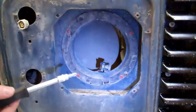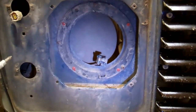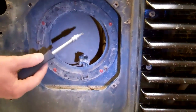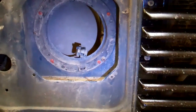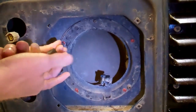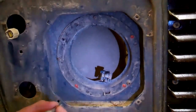So we've taken the old headlight out. Now we're going to remove the headlight mounting assembly and put in a new headlight bowl, as I used to call them, although this, as discussed in the earlier bit, isn't a bowl really because there's nothing at the back. So I've coloured the screws we need to remove with the nice orange pen. Obviously, on your car they won't be orange, only a sort of rusty orange. So let's whip these out.